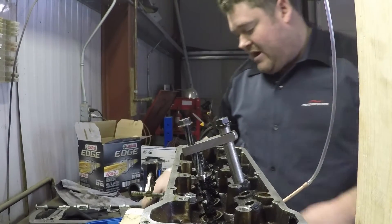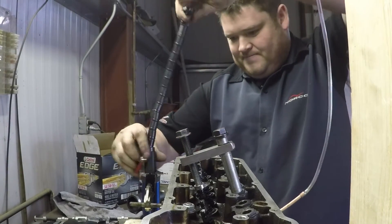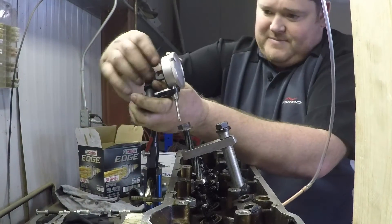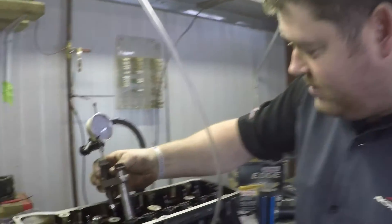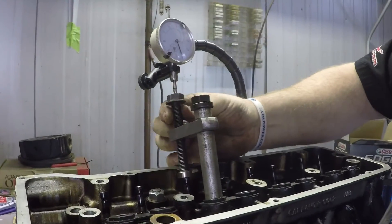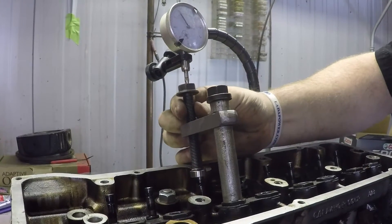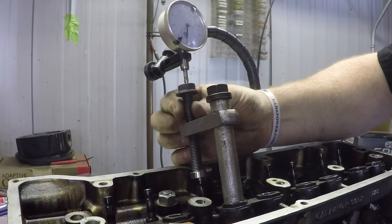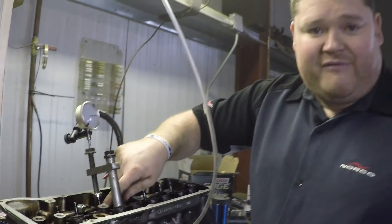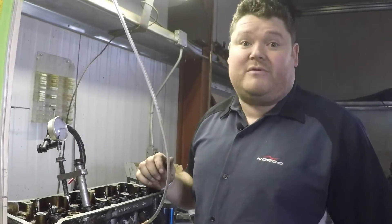I just don't like to clamp to the aluminum if I don't have to. We ran into a bit of a snag on our dry test of setting this up — we actually ran into a problem. The magnet is not staying glued to the bolt, so as we try and adjust things or when we put vacuum on it's actually pulling away and not giving us a proper reading. So we have to disassemble this, put a small valve spring in to help hold the valve, and then we'll start over essentially.